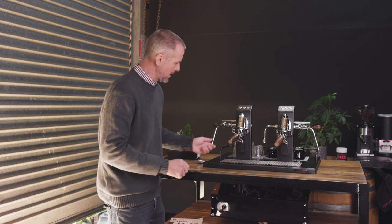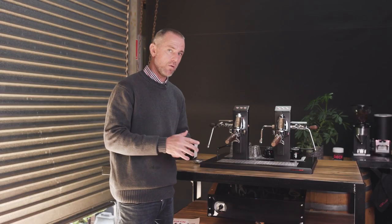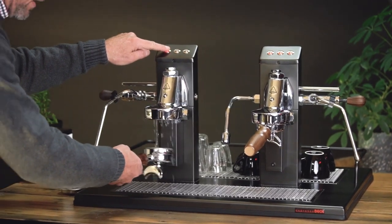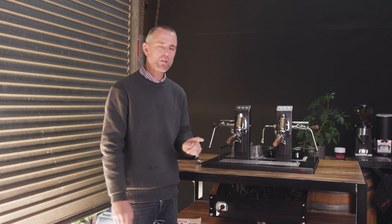How does it happen? People cleaning the coffee machine at night put the cleaning powder in, go through the whole on-off cycle — there is a separate video on that — then might quickly rinse the group handle and think the job's done, leaving some cleaning powder lodged in the three-way solenoid valve. The tip is to do an extensive back flush with just plain water at the end of your cleaning with chemicals.